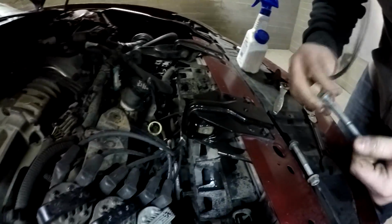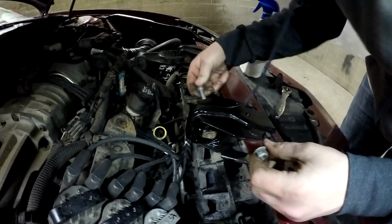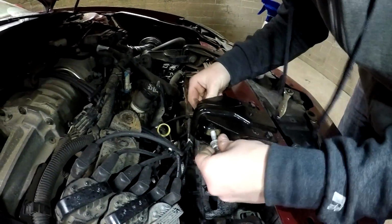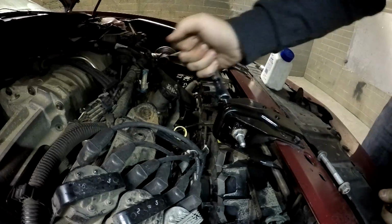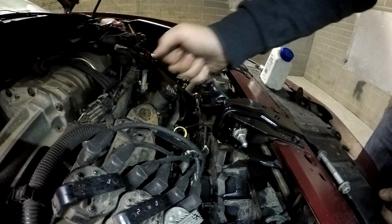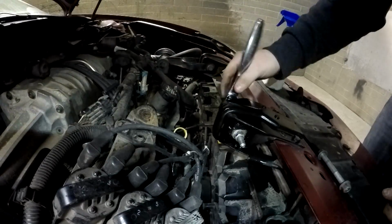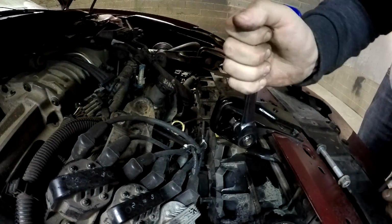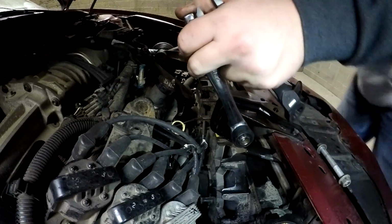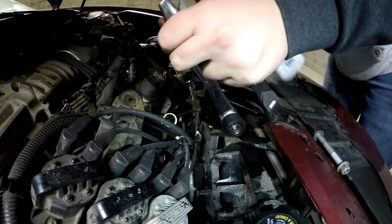And then you take your bolt and nut, put it back through here without this part of the dog bone mount. And see, it's kind of ready to turn, but you have to be careful when you do it so that, like I said, you don't rip the rubber, because then you'll just have to buy new mounts anyways.